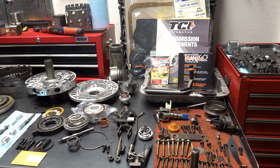So we're going to be doing a Corvette servo. That's one of the minimal upgrades I do. It's kind of a standard base package. I never use the 553 or 554 servos. The VET servos give you about 15 or 20% more applied surface area, and they only cost like 10 or 12 bucks, so it just makes sense to do it.